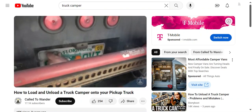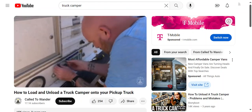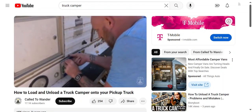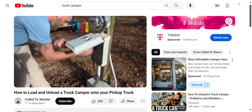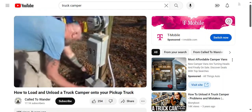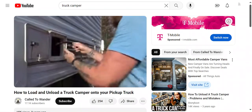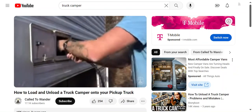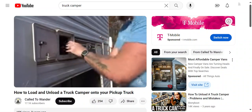The first thing you're going to want to do is switch the license plate from the truck to the camper. If you forget it, you'll be crawling underneath your truck camper after it's loaded. Next, disconnect the camper from any connections — if you're storing it you may have it connected to power, and also think about water and sewer connections if you're at a campground. During this step, also put your slide-out back in if your camper has one.